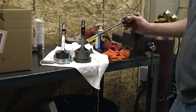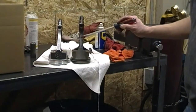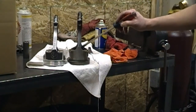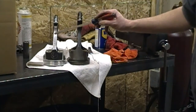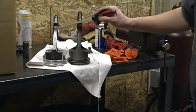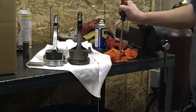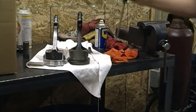Taking a look at the rods, you can see the original factory rod has a parting line in it. This is a forged rod and they grind this down. To make it stronger, I went ahead and polished it off with sandpaper rolls on my die grinder. I had these rods shot peened. Of course, they were magnafluxed and reconditioned, and I also have them fitted with ARP bolts.